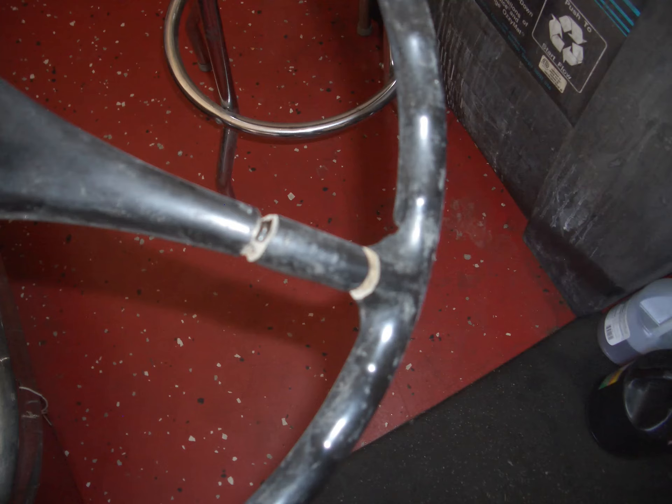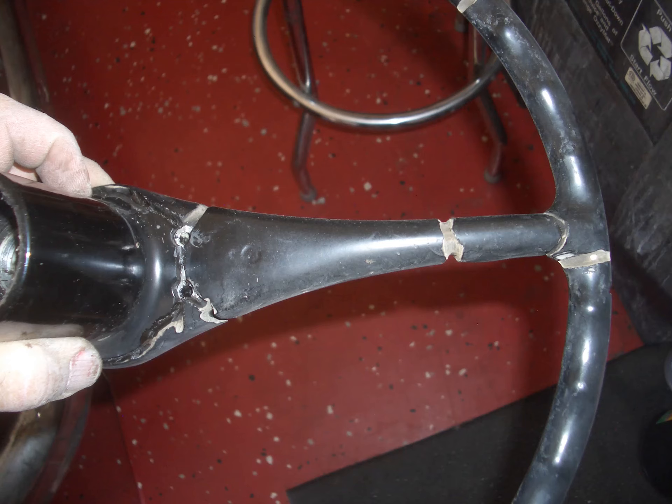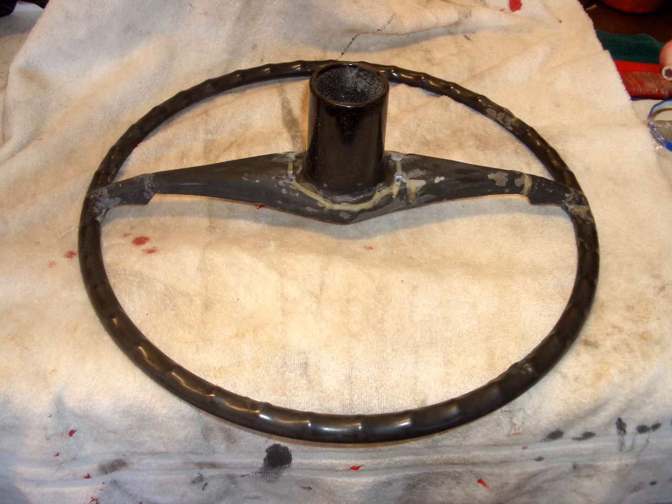As you can see, some of the cuts I had to make were quite deep to get down to — well, actually there is a steel frame underneath — and once I got down to that I was satisfied that it was deep enough. The idea was to remove the crack and give me enough space to put the epoxy in. Of course, as I previously mentioned, I used black plastic filler. Not that that really mattered — it doesn't matter what colour the filler is because it's all going to be coated in primer and then painted. It was just the one I picked up from the store.